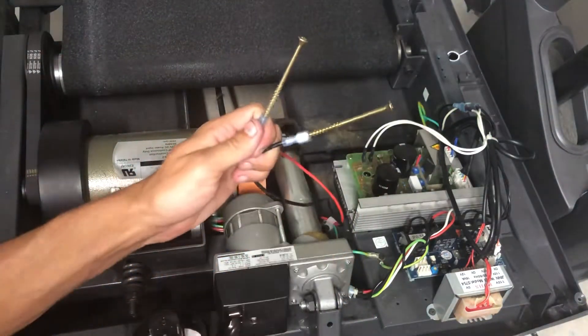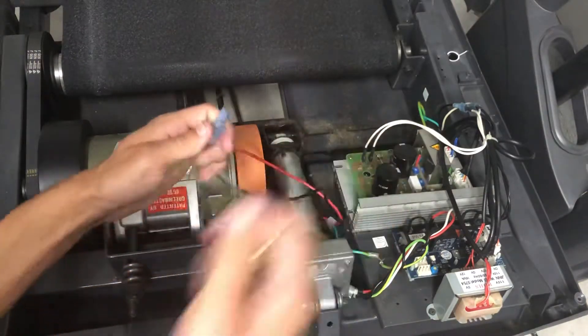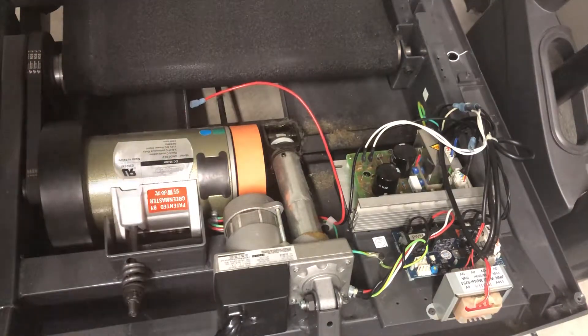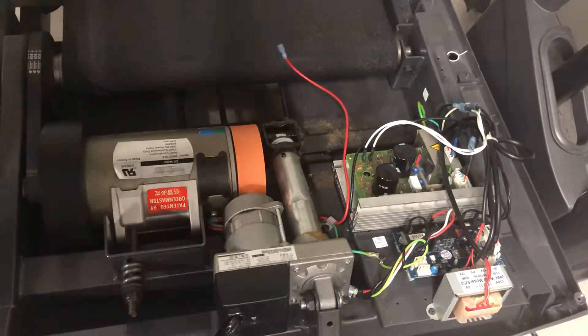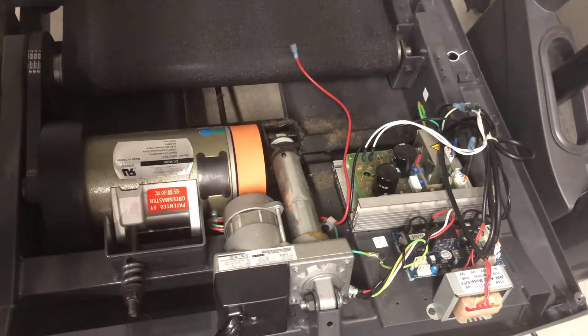And that is how you can test your motor to see if it is actually bad, because these motors can get pretty expensive. From there I am leaning towards a speed controller, or possibly that entire board itself may have to be changed. But overall the most expensive item on this treadmill is still running. So if you want to test your motor and you may not have tools and multimeters, you can take your drill battery and you can learn a lot from that.